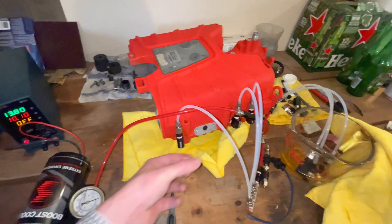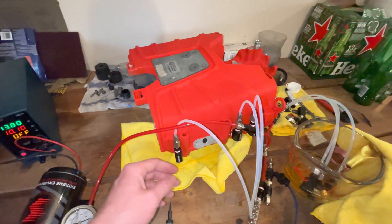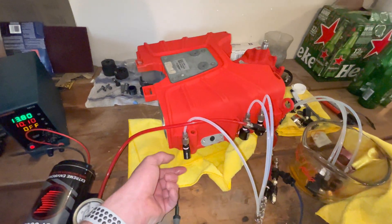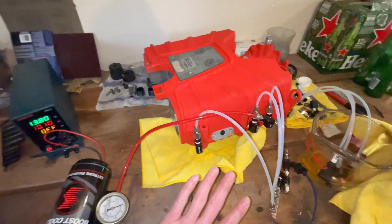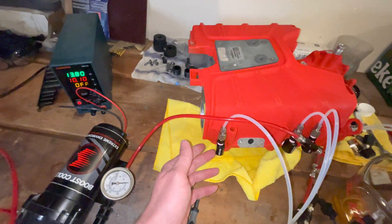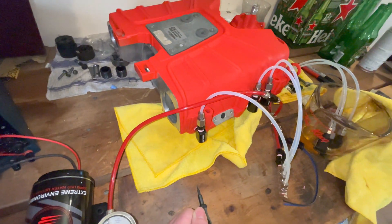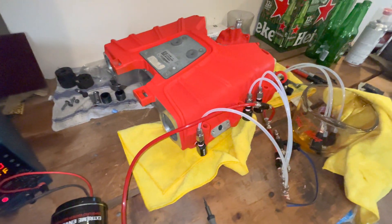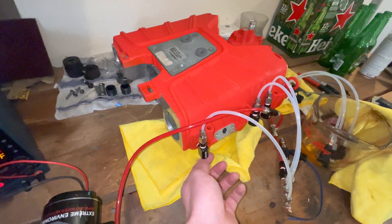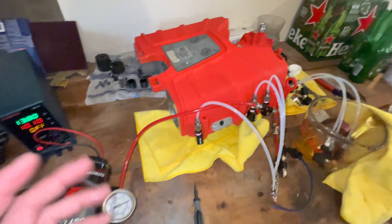I did have to grind the - there's like a cam girdle on top of the head. They usually have valves there for cylinder delete on other platforms or other engines. On the three-liter TFSI it doesn't use it, so it was just extra material that was there. I did take off the cam cover, measured the thickness - it was about 20 to 25 millimeters thick. I pulled five millimeters out of it, so I'm well within tolerance. I don't think I'm going to have any issue with leakage. I have run the car right now with the stock blower back in place just to see if I'd have any oil leaks and there's nothing.